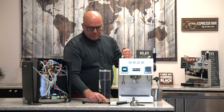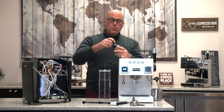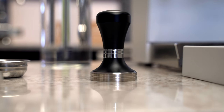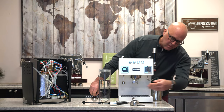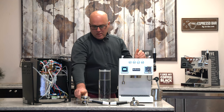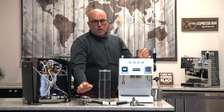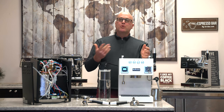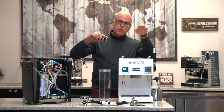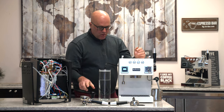My voice is starting to give out a little bit. You do have a nice heavyweight tamper included with this machine, which is another nice feature. There are marks going around so you can know what level you're at. One thing you'll notice is this is a little bit on a slant, so it's not perfectly even — it would be nice if they changed this, but there is no machine that is perfect. Each machine has its own pluses and minuses. Make sure when you tamp, you go down and use the ring to make sure the tamping is level. That's true for any espresso machine, but they thought of this little feature, which is really nice.